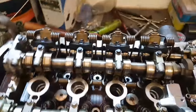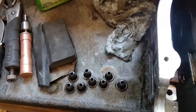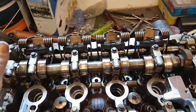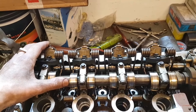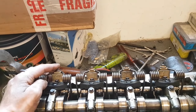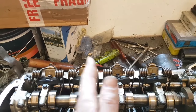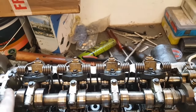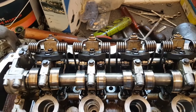This presents a huge problem, because in order to lap your new valves in — which is what I've just done with this cylinder head, you can see the old valve stem seals — you've got to remove this unit. The way I did that was to loosen each of the springs; they are under tension so be prepared for them to come back. They won't fly back as such, but just be careful. Then we undid these two bolts, took out the two intermediate rockers, lined them up to make sure they go back where they came from. Then you can just undo all the bolts and remove that whole section to do what you need with the head.